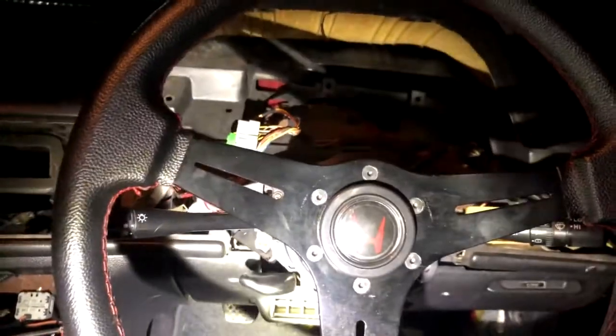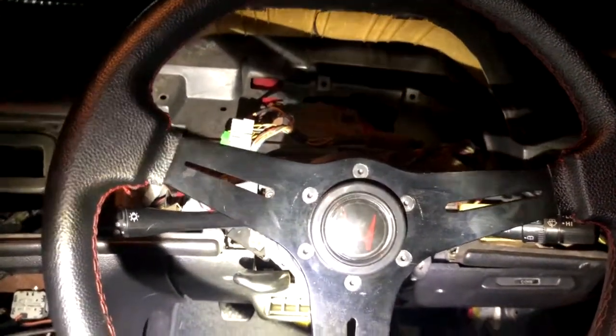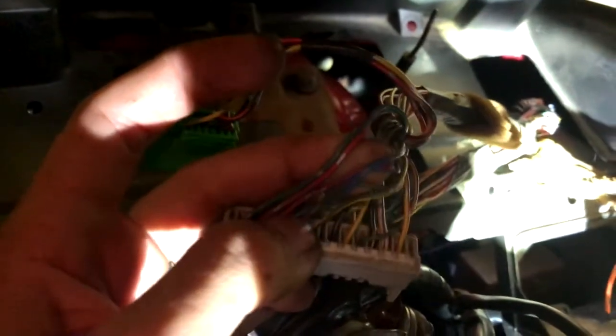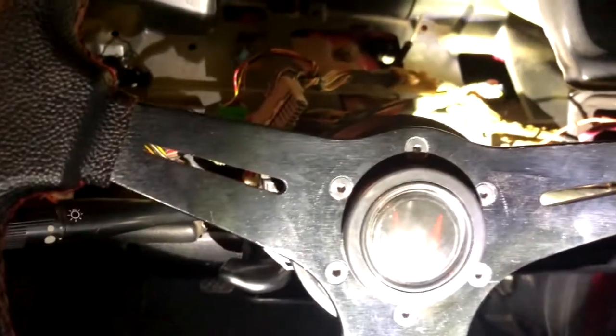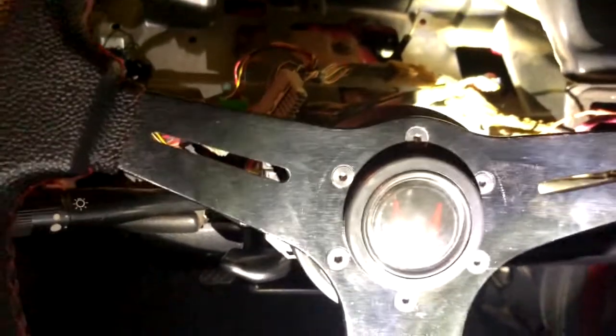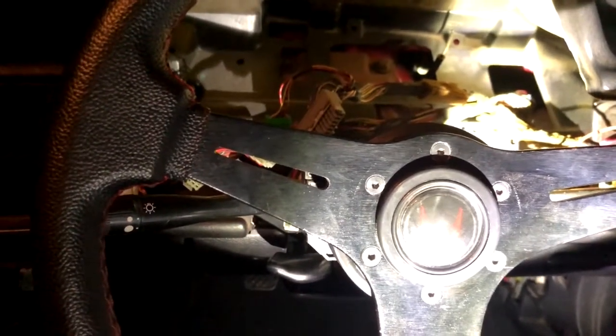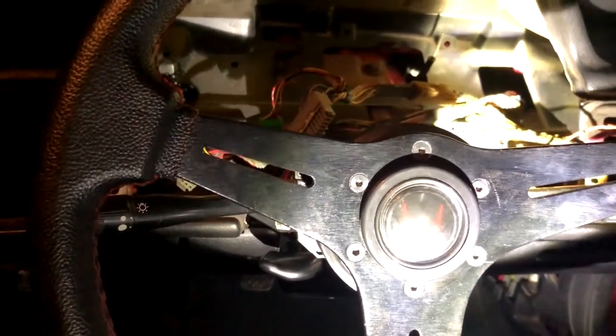And then the tachometer, well, it wasn't working, but it's sending voltage to the lead, which is basically the blue wire on this harness right here, and that one's getting voltage. So there is a signal, but the whole dash is basically not working. I'm not sure about the fuel. That's going to be for another day. But I was getting all that fixed.